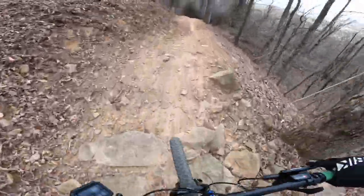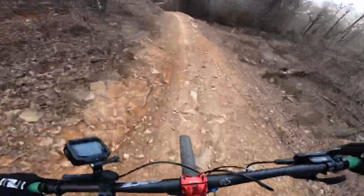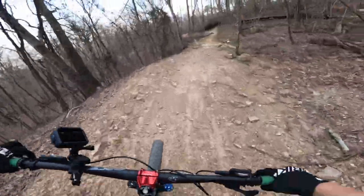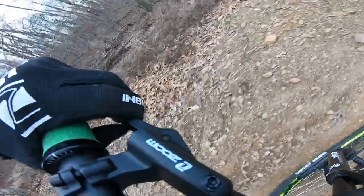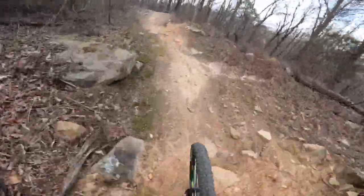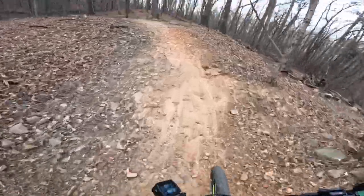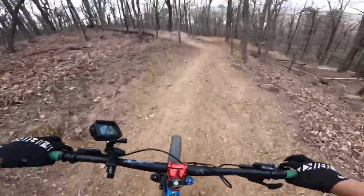Let's go to one finger. Again, hitting my knuckles. Good job slowing me down — they're biting on these rotors really good. These are those Clark rotors we talked about. I love these Clark rotors — they're stomping down pretty good. After all that stopping and squeezing of the levers, I will say they're starting to engage a lot sooner than they were in the beginning. In the beginning they were hitting my knuckles with one finger. Now that we've been pumping them up, I'm not even hitting my knuckle and I can do a one-finger stop because of all that build-up. That's one thing the MT420s definitely did not do — they did not feel any different from start to finish. And that's really important to not have that feeling on your bike.